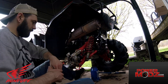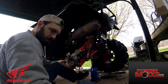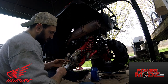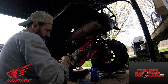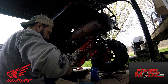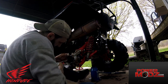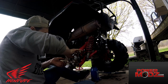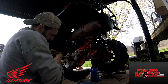Now go to the rear. You've done the same thing — 14mm, take off the nuts, take your tire off, then you've got to take the cotter pin out of the castle nut. Demon axles come with a new cotter pin. Most axle companies send a new cotter pin, but I'd let you know for the odd reason they don't. All the axles have one, so it's all good.